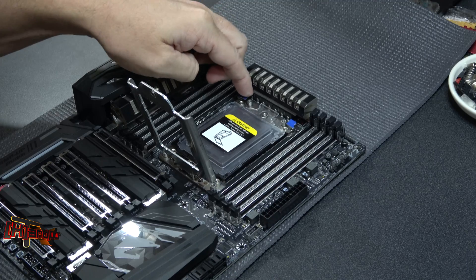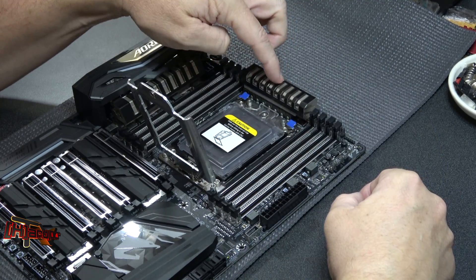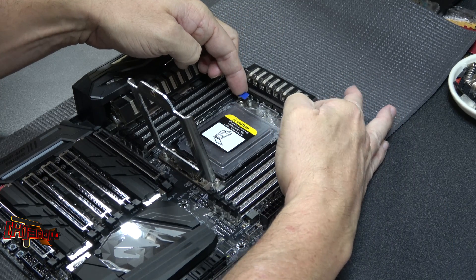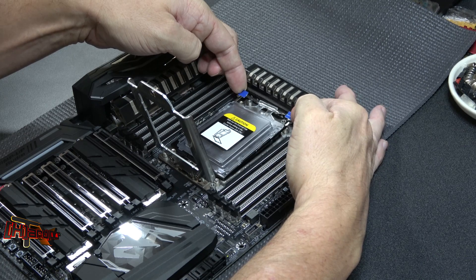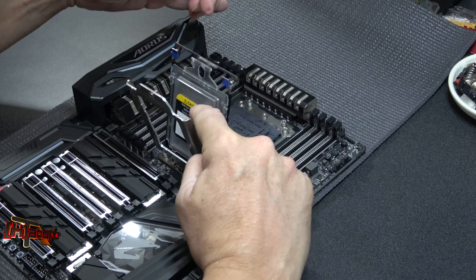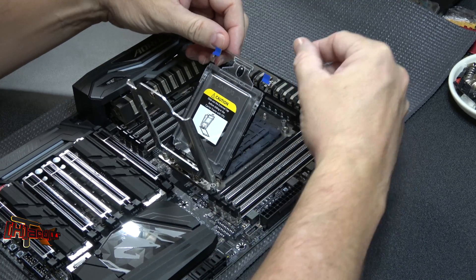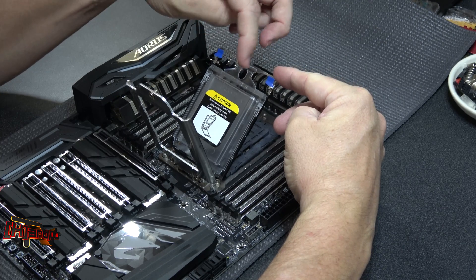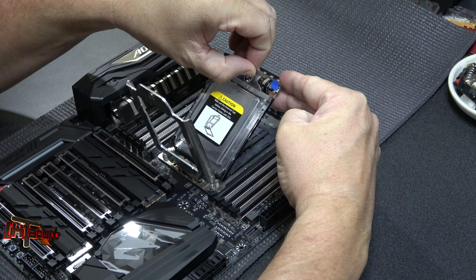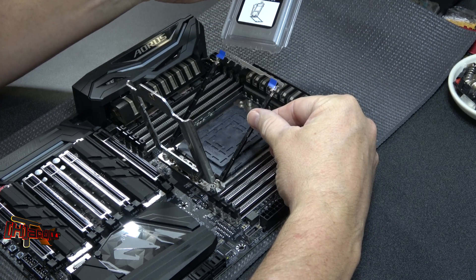You can see these are kind of bent up at the end, so you could leverage those up with your fingers that way. But since our cooling device is in the way on this particular motherboard, you can't quite get the leverage like you'd want, so you want to be really, really careful here. This is spring loaded as well. So once we get that up, you'll see the placeholder card for your CPU in here. You need to grab that and tug just a little bit and slide out — you can slide the holder right out of there.